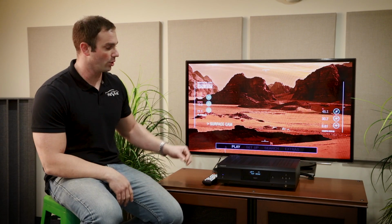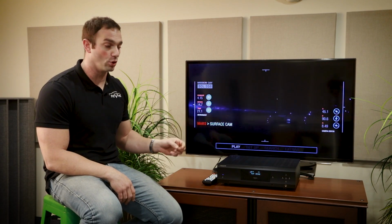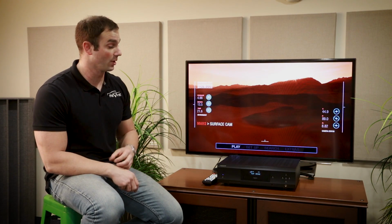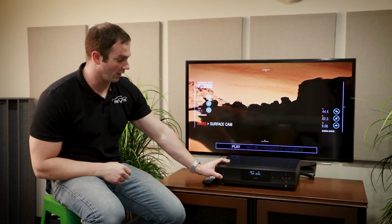So, two things. One, your CD stereo output, there are separate sets, we'll flip it around and show you, but also your 7.1 channel analog output is going to be decoded by the ESS 9038 Pro chip. That was not something that you saw in the 105 that you do get to experience in the 205. The 205 will use the Sabre DACs to do the video or movie decoding along with the CD and SACD decoding as well. So let's get this guy flipped around real quick and I can show you some of the features on the back side of the unit.